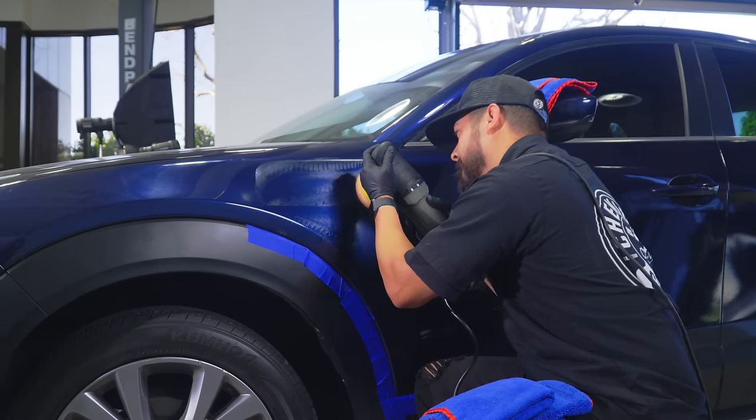So we just finished doing this section. Now, second pass, it does look way, way better, but I will say this. I honestly think that the damage on this fender, in terms of this specific scratch, might've just gone a little bit too deep, because you can actually see it imprinted underneath the actual panel itself. I know it sounds kind of crazy, but you can see the actual scratches within it, almost like it's dented into the panel with the paint just pushed down into it. So, unfortunately, I honestly think it's too far gone for us to do anything much more to it besides just refine it.